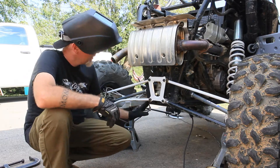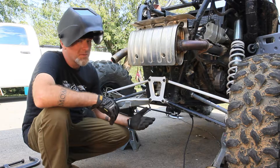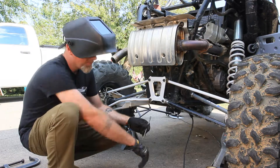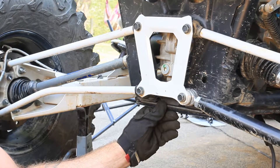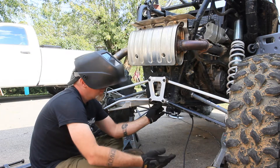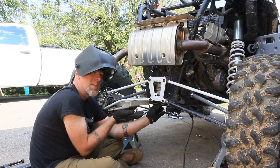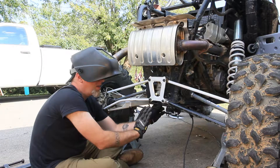Once you've got the plate welded on at the bottom, it's seam welded all the way around. Be patient — remember you're welding upside down for the front section especially, and for the most part on the sides, so go slow and make sure it's super clean when you get started. On the back you're going to have a gap. The factory plate is stamped and it actually raises up on the inside. Taped to the back of these plates will be a little 7-inch piece of 5/16th rod. What that's for is to bridge this gap back here — you're just going to slide it in from the gap just like that. Seam weld the top of it, seam weld the bottom of it, and now you've got it nice and tight and rigid. This is going to be much stronger than that little thin stamped metal that's bent. The little tube on each side comes down — you're going to want to bevel that flat, grind it flat with the bottom of the frame rails. That way the plate sits flat and the gap will work out to where it's about 5/16th rod.